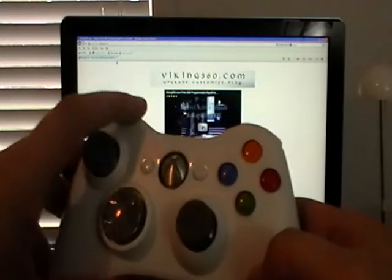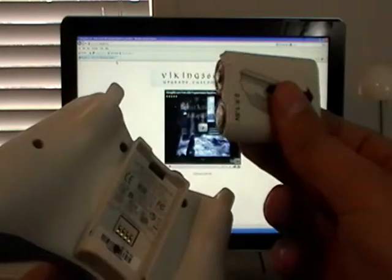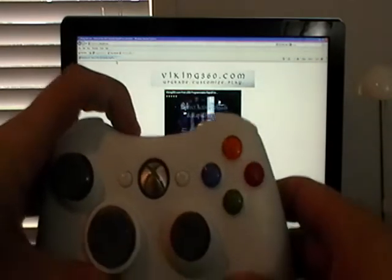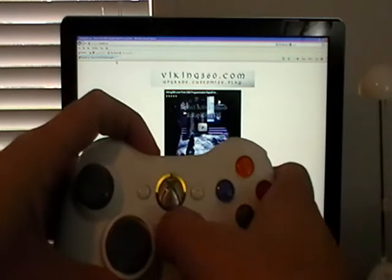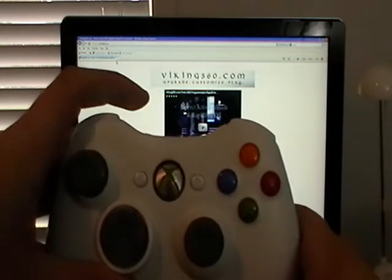Let's go ahead and put the controller into programming mode. If you haven't already, power off the controller — you can do that just by pulling out the batteries. Hold down the sync button up here on the top while powering up the controller. You're going to see those two bottom lights turn out pretty fast. That means it's in programming mode.